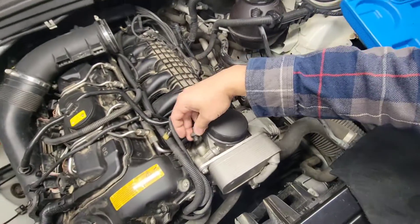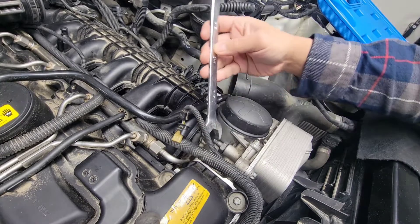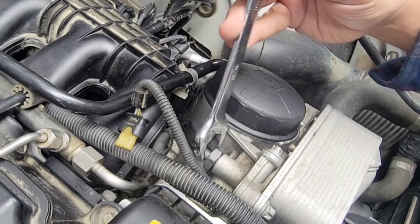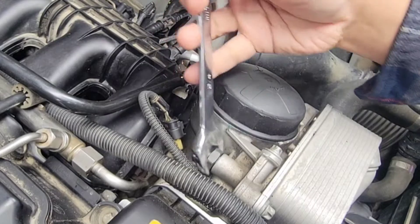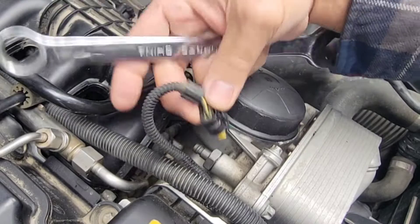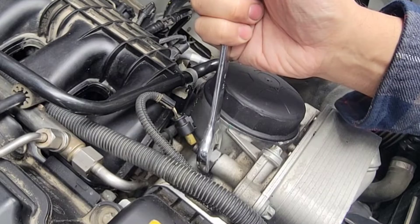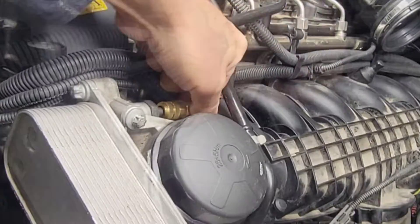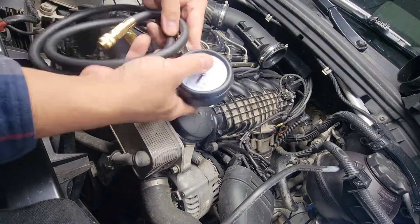Screw it in here — just a quick snug. I use a three-quarter open-end wrench, just snug it up. When you start the engine the engine light's gonna come on because the connector is not connected. It would be nice to have a T-connector so we could keep the oil pressure sensor wired during the test. Tighten it up nice and snug, then the quick connect goes in just like that, and then the main pressure hose with the gauge will snap right in here.